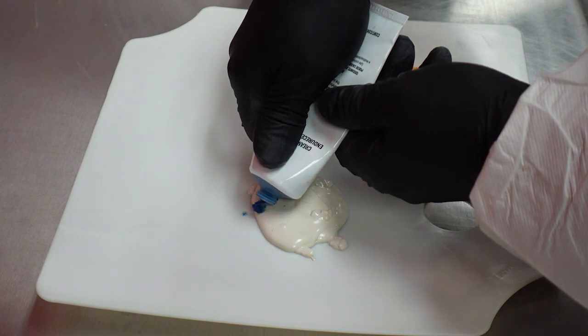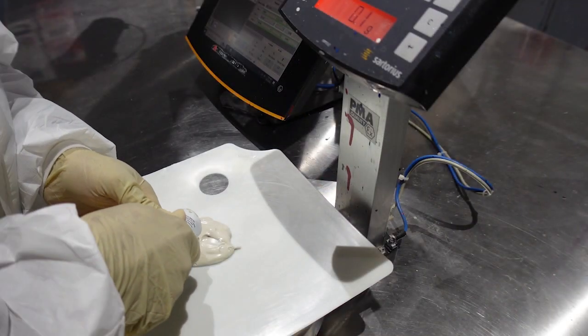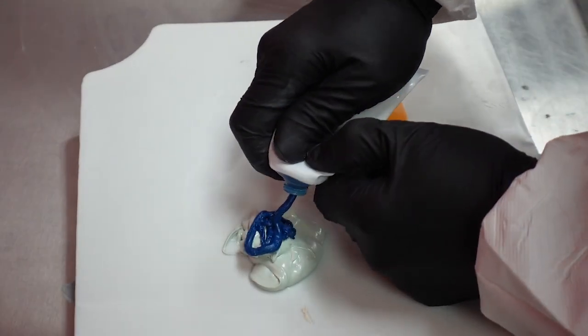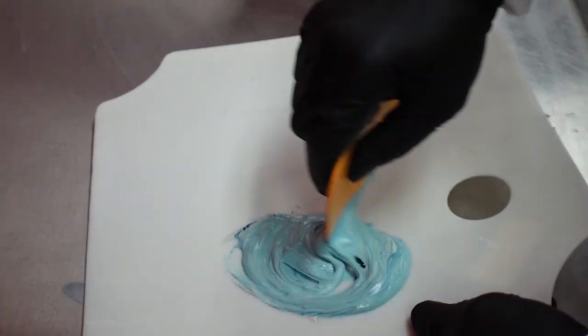It's very important to follow the mixing ratio correctly and add only the required amount of peroxide hardener. If excessive hardener is added to the mix, additional heat may be generated during the reaction process, which may cause air entrapment within the filler, which could then show as pinholes in the surface. Inappropriate or insufficient isolation of the body filler itself with a 2K surfacer or filler will also lead to pinholes appearing in the course of the refinishing operation.